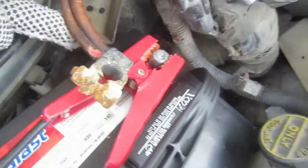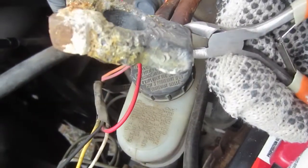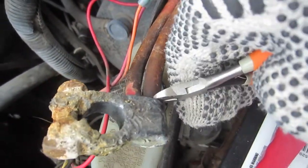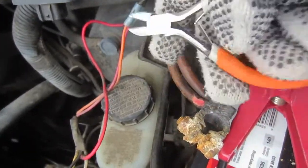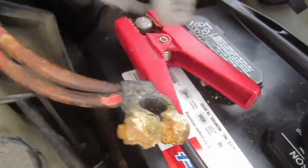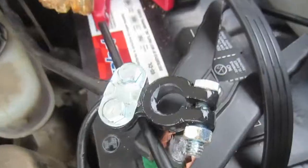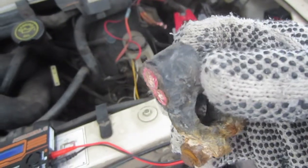That could be the source of my problem. First step here is to remove the clamp from the cables. This is a welded joint so I just have to cut the cable at the clamp with these really crappy wire cutters. It works — I did it with this one already. I replaced the ground already, but we were worried that two wires wouldn't be able to fit into this type of clamp. But I can make it work. A lot of little cuts and it's off.